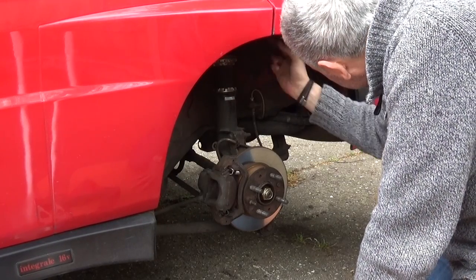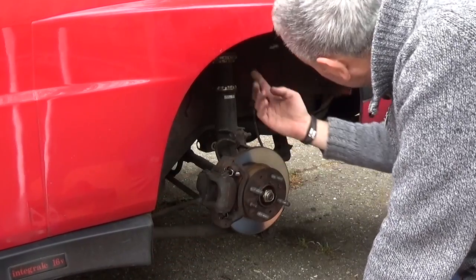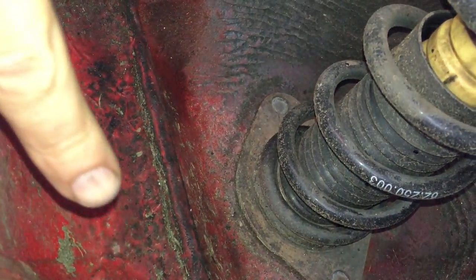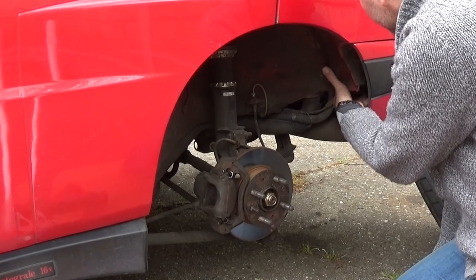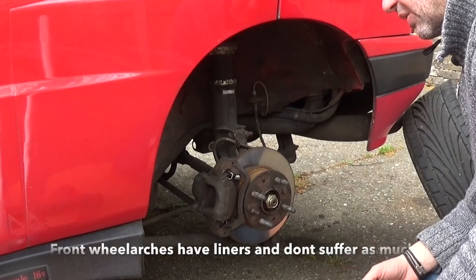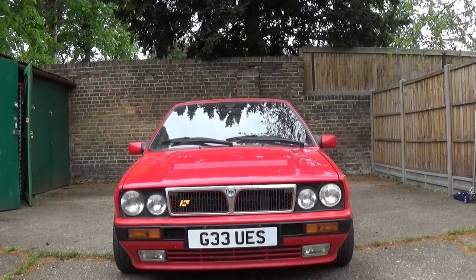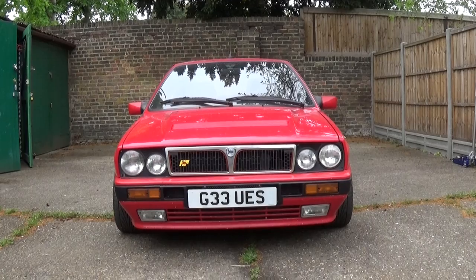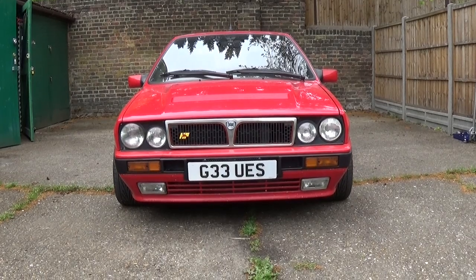On the sills and arches make sure you look at the seam — make sure it's not splitting too much on each side. Look under the rear sills as well, and right at the top of the wheel arch skins where the metal is quite thin. Where it meets up with the boot is a notorious area, so make sure you check that thoroughly. Most of these cars are pretty old now — they'll have had some rust and some repairs, just make sure that if they have, they've been done properly. Good luck — they are fantastic fun, really great cars. Thanks for watching.